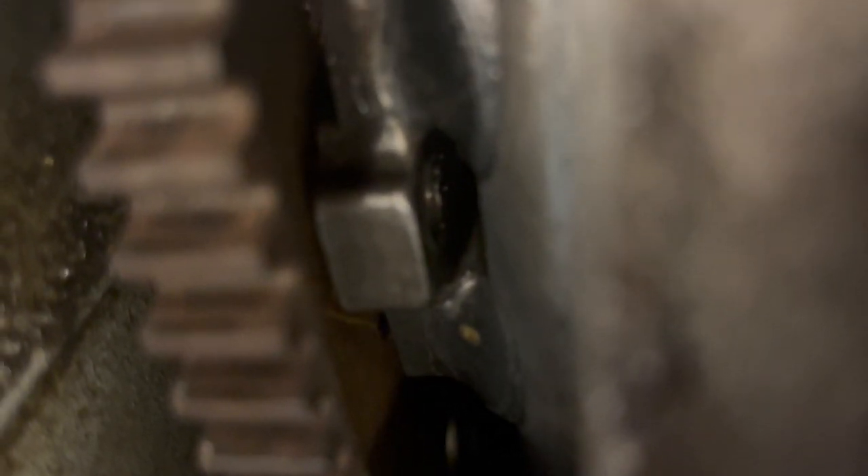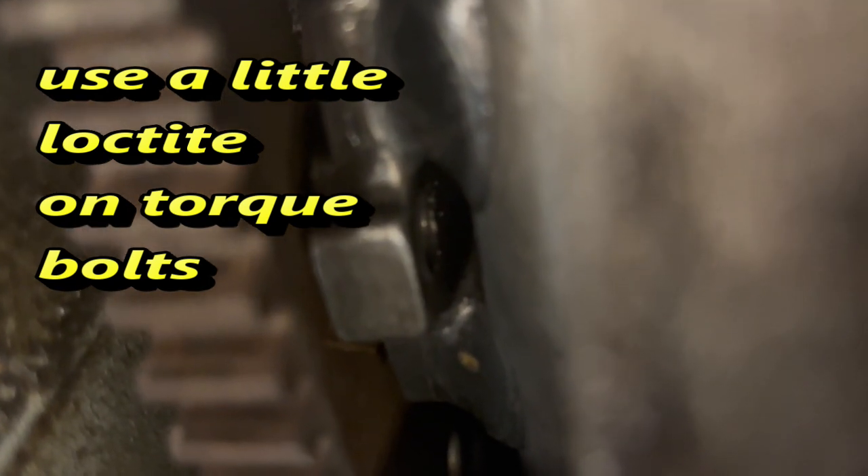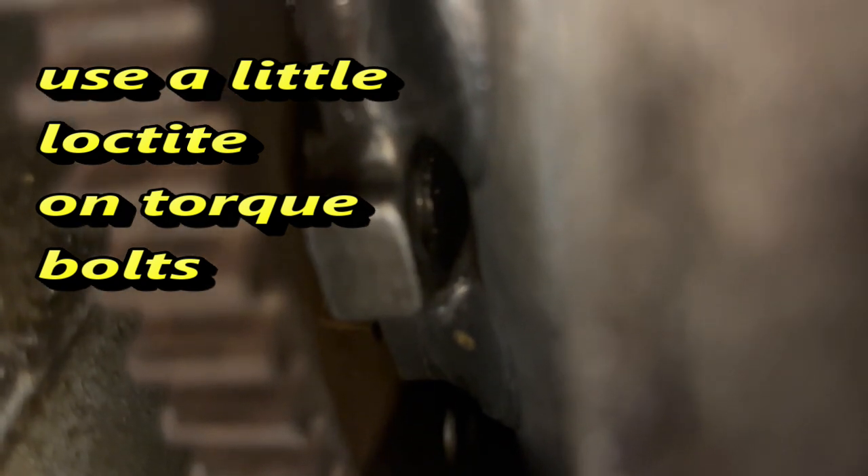So we're all bolted up to the engine, ready to go. I'm going to turn this converter so I can show you how loose that converter should be — you see that converter lug moving right there. When you go to bolting this up, what you'll want to do is line up one bolt, tighten it all the way in, run it back out about a quarter or a half turn, and then turn your flex plate around to your next bolt and put it in, and so on and so forth till you get all three of them in there, and then tighten them all up from there. So I hope this video helps you and please subscribe.